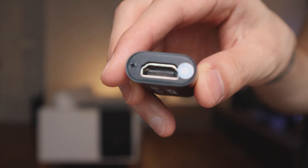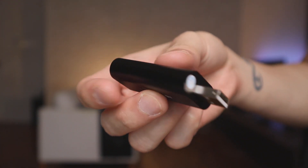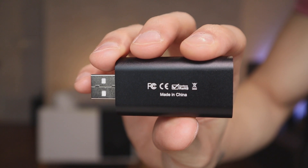So I saw a YouTube video from a guy called Epos Vox a couple of weeks ago about this HDMI capture card — this one over here. It's basically a Chinese knockoff, and it's very different from the Elgato Cam Link. This is USB 2.0, the Cam Link is 3.0. It can input 4K video resolution but can only output 1080p at 30 frames per second, or 720p at 60 frames per second. The specs are way lower.